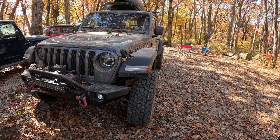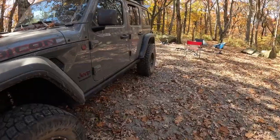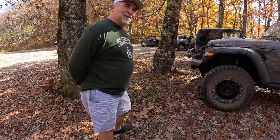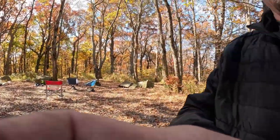They aired down on this trip and it made a big difference — 35 inch tires aired down feels like floating on clouds. You really notice the difference when you go from dirt to pavement. Just airing down to 20 pounds on fire roads was a 100% difference in the ride. Highly recommended, along with having an air compressor to air back up when you return to pavement.